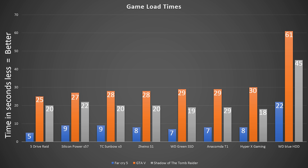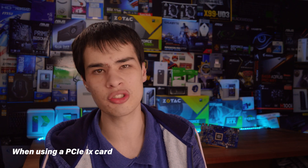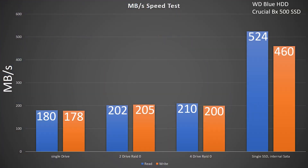The slower 1x versions are not going to be great for performance. But what they're great for is hard drives — lots of hard drives. The PCI Express versions only deliver about 200 real-world megabytes per second. Hard drives don't run very fast, and if we're not relying on these things for fast RAID, they're actually absolutely awesome.